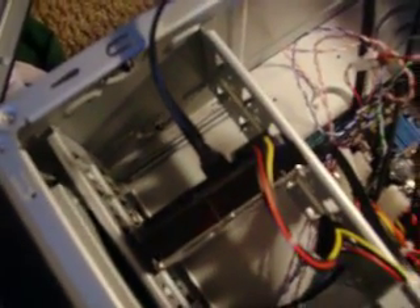Hard drive — SATA hard drive — SATA cable to the SATA on the motherboard, and then power coming from the power supply. There's an extra four prong pin there. I don't think I need that — I think that's for an additional power supply.